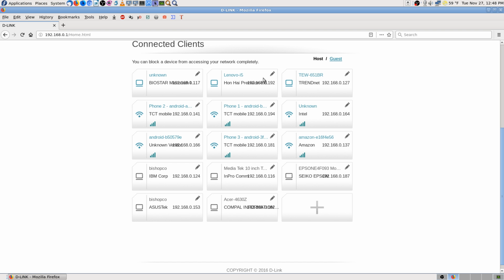No Wi-Fi. That's the one I'm streaming from. TrendNet router. Okay, now it's showing up. See, it never showed up before because it was on the D-Link, TP-Link, and then the TrendNet. The firewalls in all the routers would not allow you to go. It thinks your connection's coming from the WAN, the wide area network, the internet, and so it wouldn't allow you to go to it. So now I can connect to them. I can transfer files. I can do remote desktop, whatever I need to do to any machine.